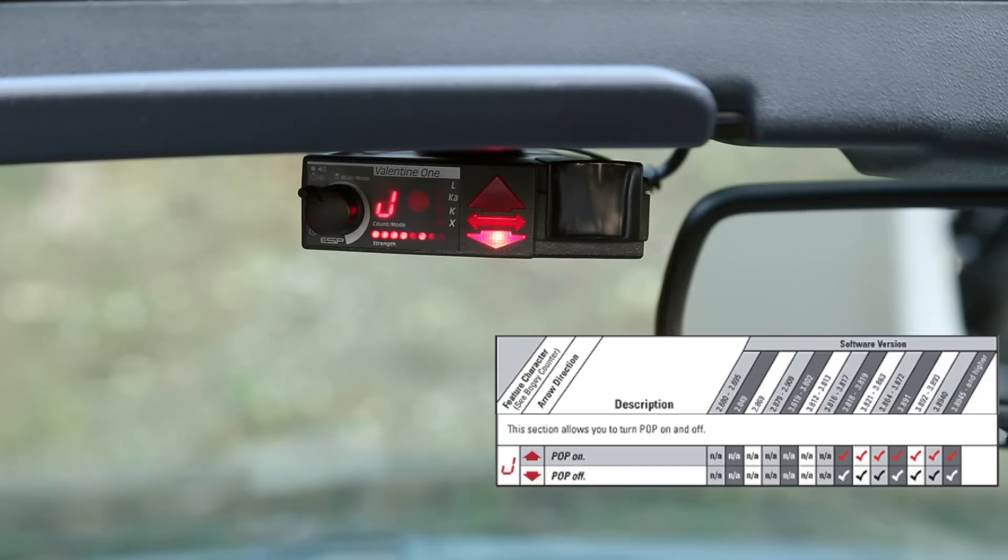Realistically, the main benefit of turning off K band pop is reduced falsing from cars with blind spot monitoring systems, without the degree of penalty you get with TMF or TMF2. That's why I actually turn it off for times when I'm not running their new junk K fighter — I get reduced false alerts from cars like Audis. For those overseas using a 67-millisecond K band pop gun, you'll want to enable this feature.